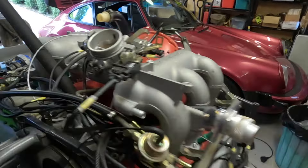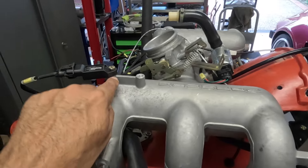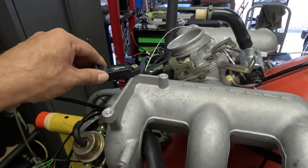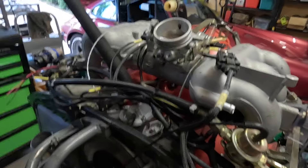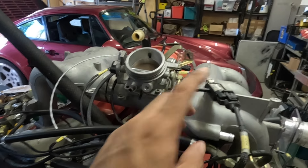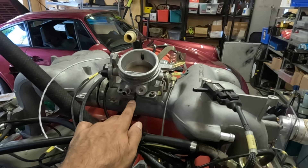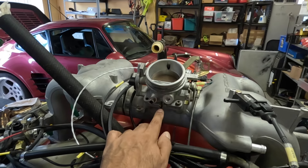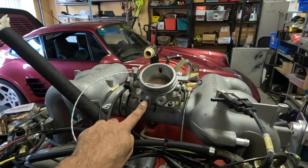There'll be an aluminium tube coming in here and then there'll be a temperature sensor on the back of that - that's where it'll take its air temperature from. The MAP sensor is just waiting for one of those rubber isolation mounts which will just sit there and I'll mount my MAP sensor there for the time being. One of the questions I had: where do I get my vacuum signals from? It seems unanimous that the MAP sensor is obviously after the butterfly because it wants to sense how much vacuum it's running. The other port will be used to run my fuel pressure sensor and the fuel damper. That one's going to be plugged up - I have no need for that one.